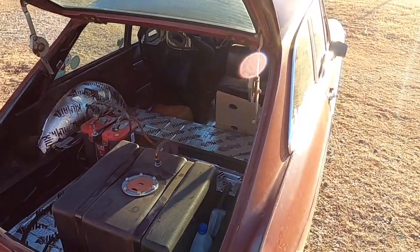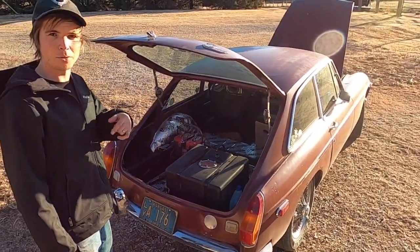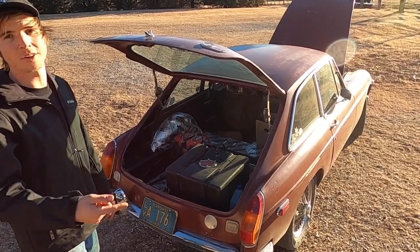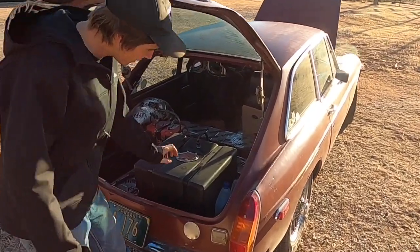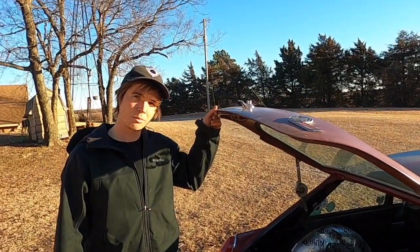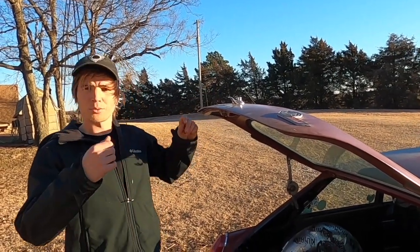Deleted the oil metering pump. Oil metering pump normally takes motor oil and injects it directly into the carburetor. That's one way Mazda got around the user-friendliness of rotaries. So I just run pre-mixed 2-stroke oil in here, and I just carry a little metering cup. Normally the secondaries are vacuum. I've converted them to mechanical secondaries, just tying up the linkage real special like.